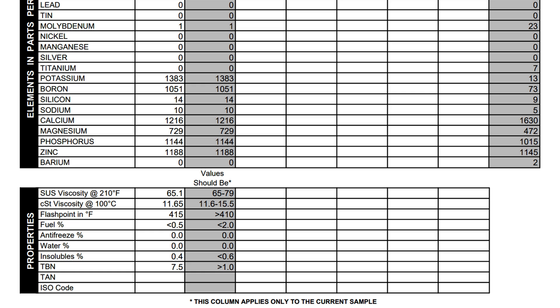I cannot stress enough that this is a complete game changer for me. If you do not want to do oil analysis and refuse to pay the $35 to have your oil tested, it's probably safe to stick to the 5,000 mile oil change intervals or every 200 hours. This report is individual-specific to your vehicle and how you drive it — I'm not going to start saying everyone should go to 8,000 mile intervals. Some people use their truck harder than me and will need to change oil sooner; others that don't tow or idle much may not need to change their oil until 12,000 miles.